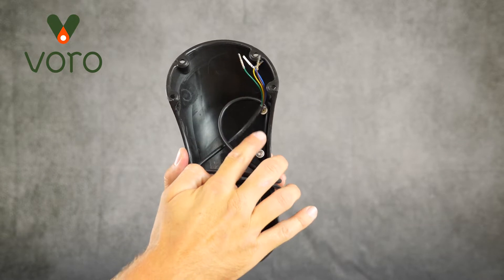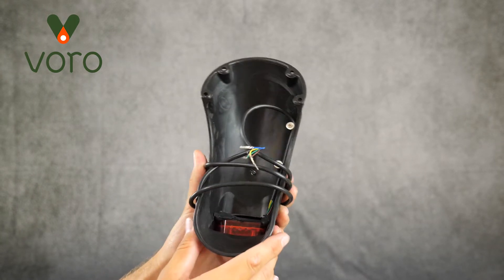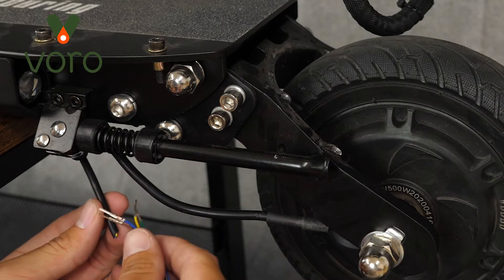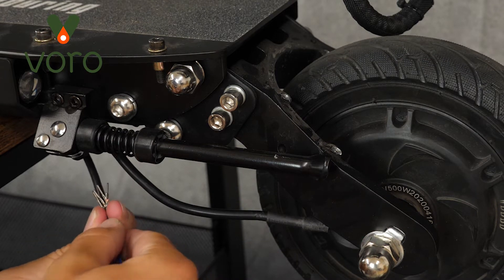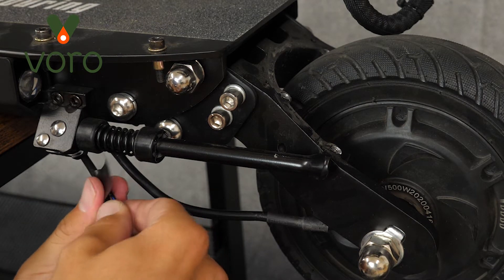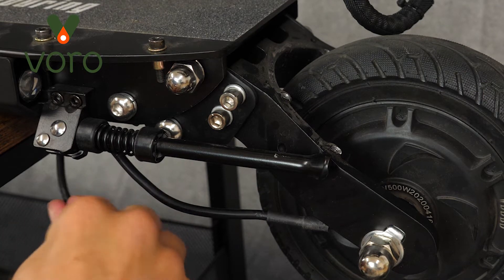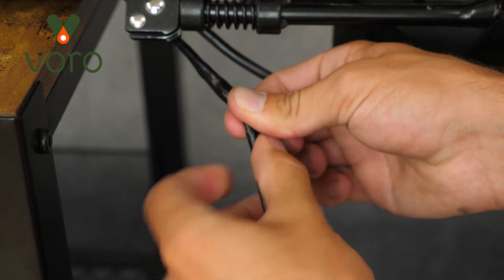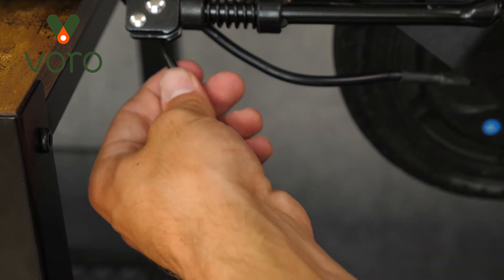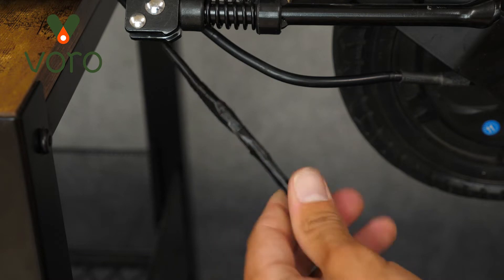With the new fender, double check that the two screws are holding down the wire — you can tug on the wire a little bit and it won't come loose. This will prevent the wire from rubbing on the wheel. Now let's go ahead and install it. We're going to tape the four colored wires from the new fender to the black wire of the old fender using electrical tape. Make sure that you get these taped down nice and tight — you don't want them to slide and you also don't want the tape to hang up. You'll know you've used enough electrical tape when you can't see any more of the colored wires; you should see just black wires and black tape. It's crucial that your tape is tight and neat.